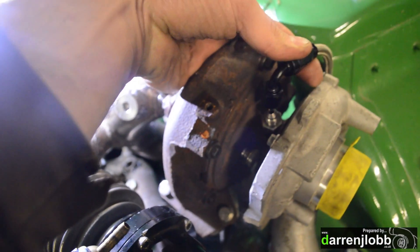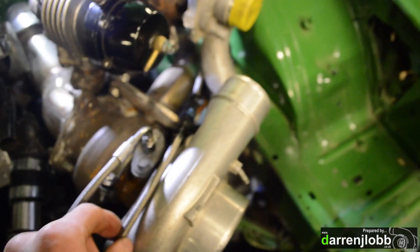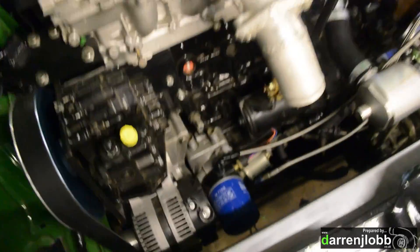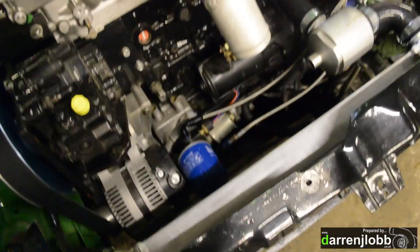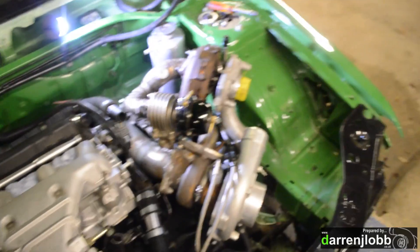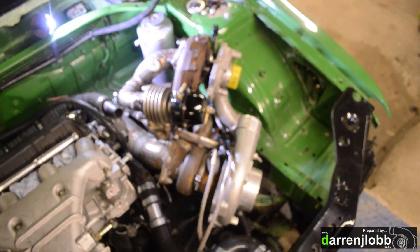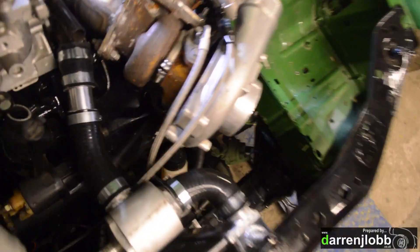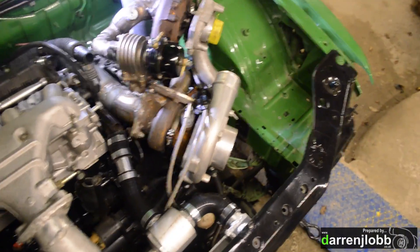This is the hose I made last time — it will work out again. So that will come on there, loop down around underneath, and then come up past and join onto that one as well. The two turbos just get their feed from down on the sandwich plate on the front of the motor. Because that's coming from before the filter, I've actually got little inline filters in these hoses just to protect the turbos.